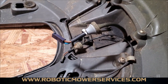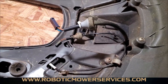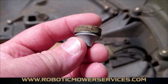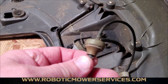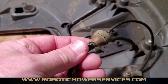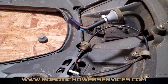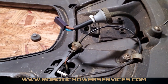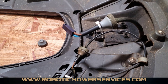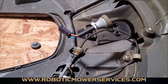So you actually had both the headlight grommet and this plug for the empty hole allowing moisture into this automower. The charging plate grommet was the exemplary one — that's what you want it to look like. You might say this is a high-cut mower, it had to go through a deep puddle to get that damage — but remember the blades are slinging stuff up there, wet grass is attracted to that, and all that moisture sooner or later is going to make its way into the chassis, especially when you've got a gap in this plug and issues with the headlight grommet. So pop them out and check them — make sure they look well seated.